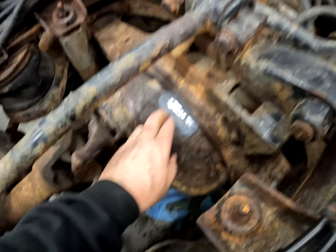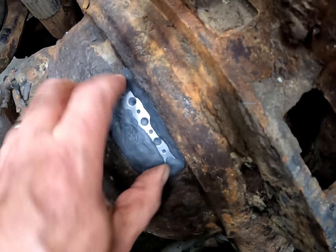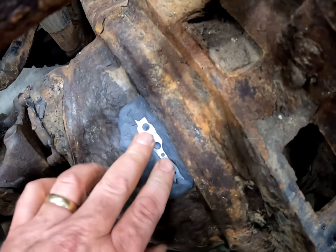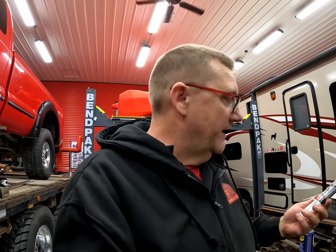And my epoxy is hard. I don't know if you can hear that, but it's set. Now I've used that style putty epoxy for fixing fuel tanks in the past, where I had a rock that rubbed a hole through the tank, and I could reach up and touch it between the frame and the tank, and I just cleaned it up really good, stuck it up in there and it worked good. But what I'm going to do is mix up a whole tube of this stuff and cover the area. So that's what we're going to do right now.